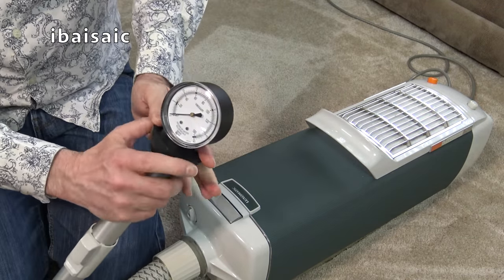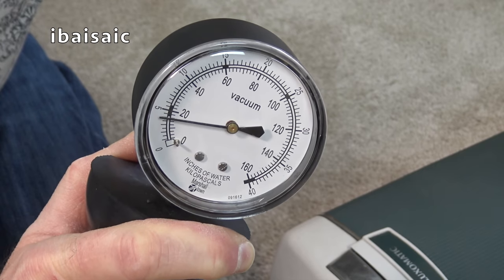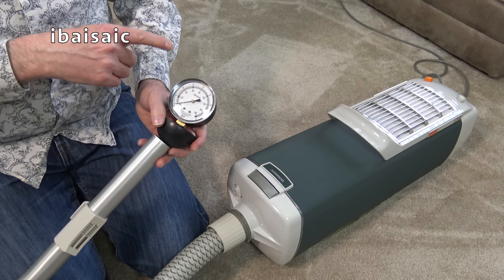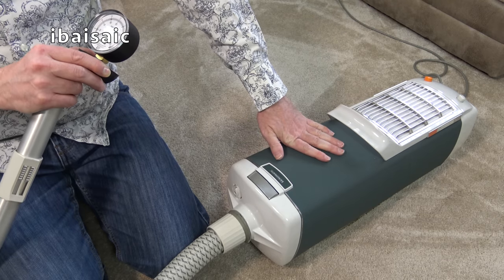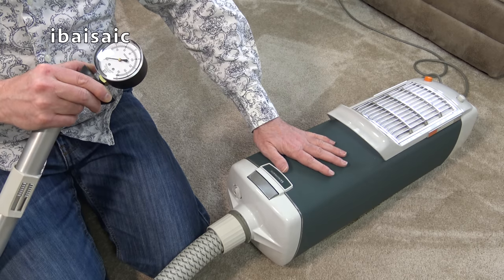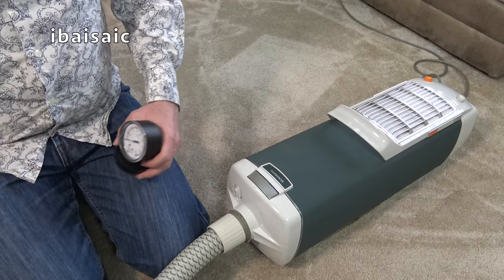Let's see where the gauge goes. I make that about 66 on the gauge, which, considering this is 550 watts, makes it a very efficient motor. I believe these have twin fans in them. Electrolux had twin fan technology way back in the day, certainly in their twin fan uprights. Basically it has two sets of fans with a baffle in the middle, so it can effectively double the suction power using a low-wattage cleaner. Of course we had uprights with about 550 or 500 watts and they had pretty decent suction. So that's pretty good going - it did feel quite powerful when I put my hand over.